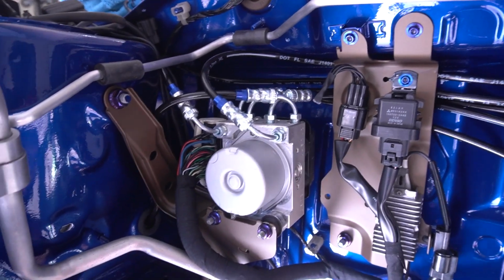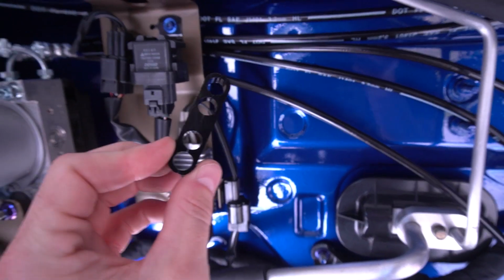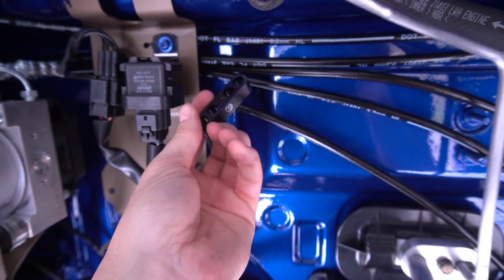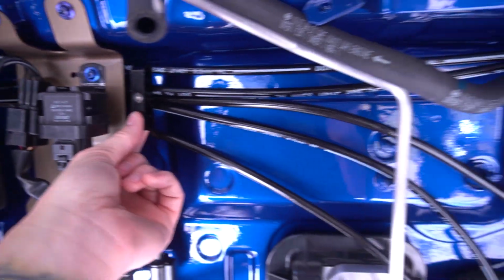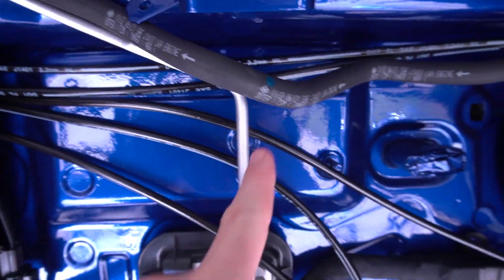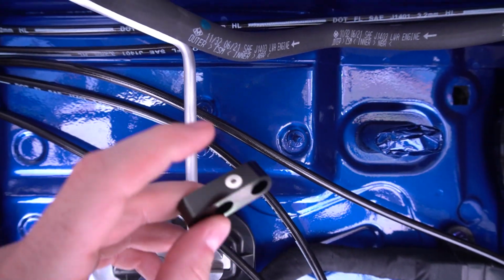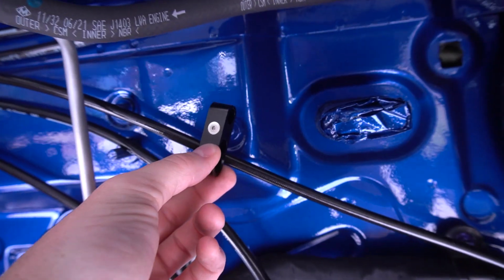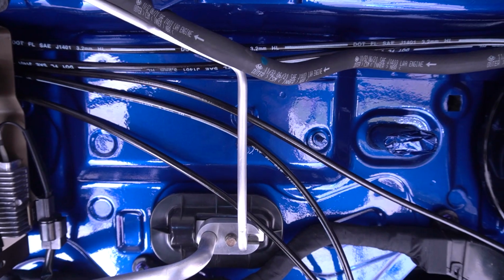All right, so if you haven't been following along, here are our new custom soft line brakes that run out and around. They kind of spider out and go where they have to go. So I got some aluminum clamps here for some hoses. This should be the right size. I'm thinking about clamping the 4 of them there since they come out behind the bracket all together. And then once they begin to split, these studs back here that are not being used, I'm gonna drill out the hole in the clamp and then run this onto the stud, and then we'll use a titanium nut to lock it down and lock it in place. I think that will work. I think it'll look pretty cool, and it should be fairly easy to do.